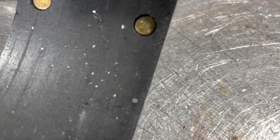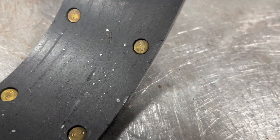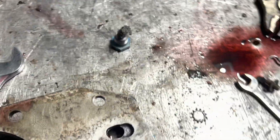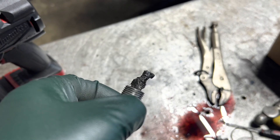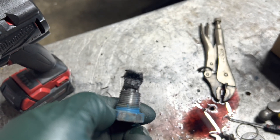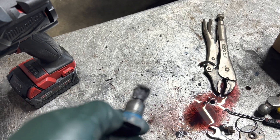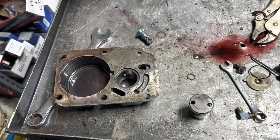Look at all the impregnated metal in the reverse band - I'm going to dig that out. Band's good, but we don't want any of that metal getting caught up in that pump. Going through the control block on our Paragon, and this is the lube feed to the V-Drive. Look how packed full of junk that filter is - so you know that V-Drive wasn't getting a whole lot of help. We'll clean all that up and put it back together.